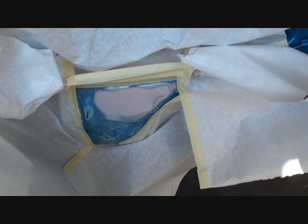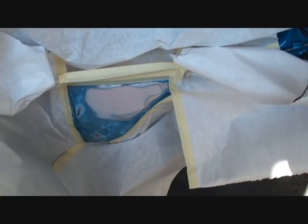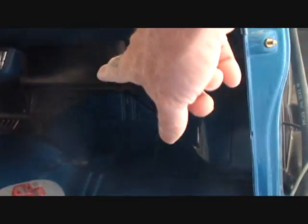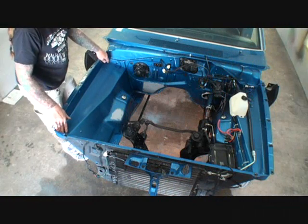He was pulling the motor out and it went right into the firewall. There's really no way to pull that out because there's an air conditioner unit in the car — I'm not going to pull the dash and everything out. You can see it's all already installed, with the AC unit right up under there. So I went ahead and pulled it out the best I could with my dent puller and then feathered it out with some Evercoat bondo mix.